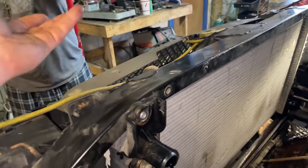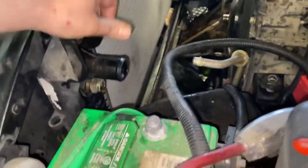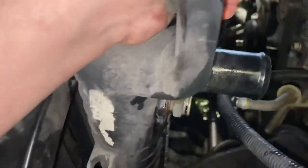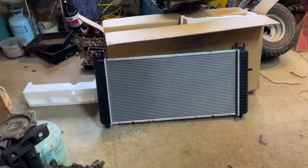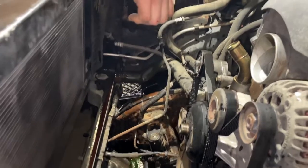Two bolts out of the top — there and there — and now it's ready to come out. Wait, we can't forget about the AC — checking if it's connected at all... doesn't look like it. There we go — press in on that top clamp inward toward the vehicle. We're just hung up on some hoses and stuff. I'm going to drop the camera to keep the hoses out of the way while Jamie pulls it out. There's our new radiator — we checked to make sure everything's the same on each side; it's the correct radiator.